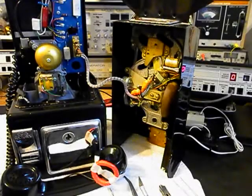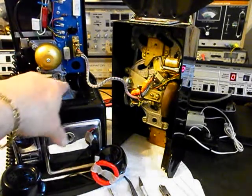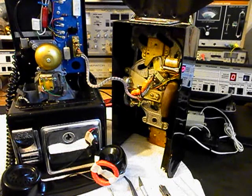We're back now and in the middle of repairing this 3-slot payphone. We went ahead and stabilized the bell and also rerouted our wires for the bell — we don't want them touching the bell and obstructing any chime we'd get out of it, so that's been taken care of. The receive issue has also been taken care of. We redesigned and reconfigured some of the connections to work the way we want them to, so that issue has been resolved. We'll check that before we start our final checks.